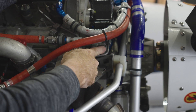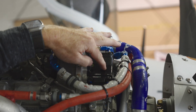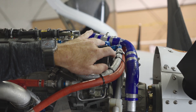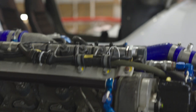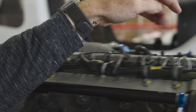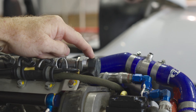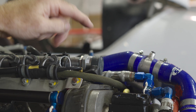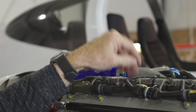It comes out of the low-pressure fuel pump to the high-pressure fuel pump, which is also gear driven. Out of the high-pressure fuel pump it goes into the common rail — that's where the fuel is stored until we use it. On the end of the common rail we have a rail pressure control valve, which takes the fuel pressure up to 18,000 PSI. We use high-pressure atomized fuel and heat to keep the engine running. The fuel delivered to the common rail by these two pumps is 20 gallons per hour.